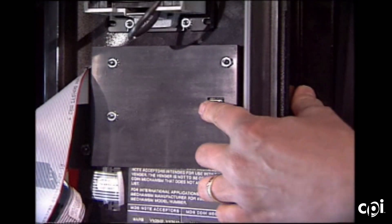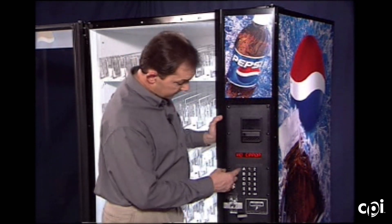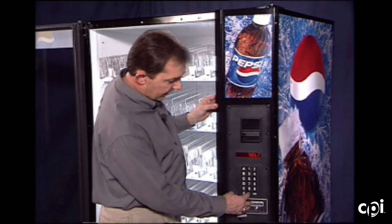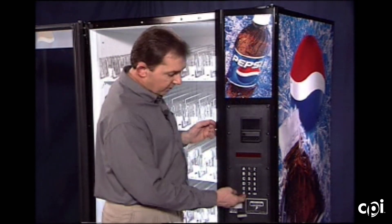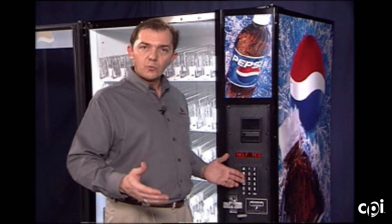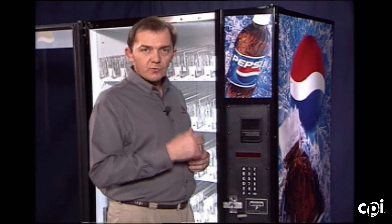We'll press the mode button one more time and go into test mode. Button A takes us to list errors — it says no error; had there been a fault it would list the errors, which are defined in the service manual. The next feature is a self test, which fires all 45 gates in rapid succession. It comes up with errors 9 at the end because the keypad goes to F but we only have 5 trays instead of 6 — it's looking for the 9 solenoids associated with tray F. So with 5 trays, you'll always get that errors 9.